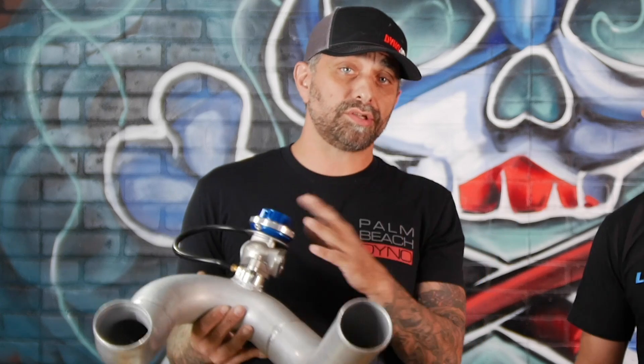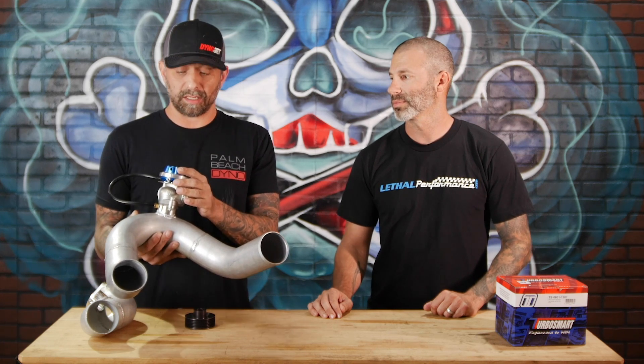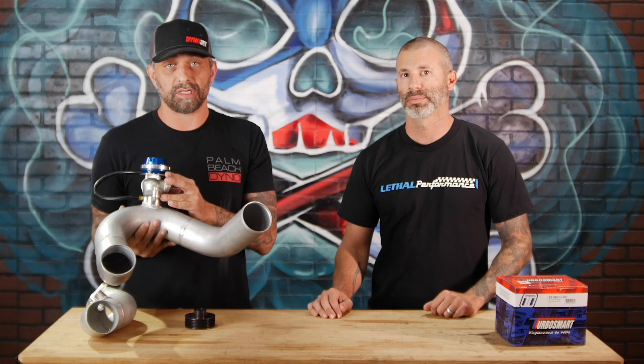The other use of this is for high-powered cars to bleed off boost for launch. We did this back in 2012 with a pro-charged car that was having trouble leaving the line in the early days of tuning the 6R80, and we went 8.60s with that setup. It's the same exact setup, except you would add a boost controller to it — it would be open when you launch and then you would close it after launch.